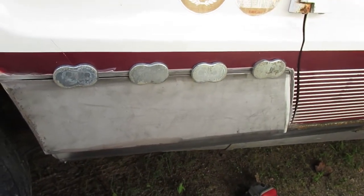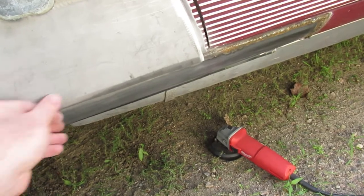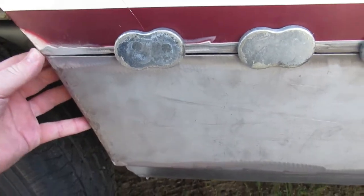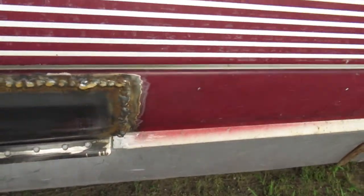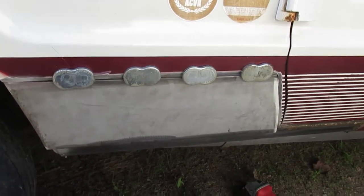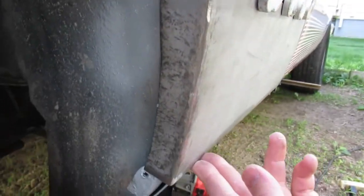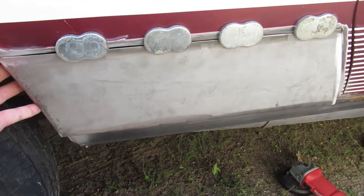I pulled out some magnets I'd salvaged — thought they might be handy in the future, and it turns out they are. I've got a pretty nice fit — I'm going to weld around the edge along the bottom and up top. My biggest concern from the beginning has been protecting the paint, and I found the heat damage isn't too bad if I take my time. I'll put cardboard over it to prevent weld spatter. I used the shrinker to put a contour on this piece so it follows the side of the van. Pretty good for a first sheet metal repair without any filler.